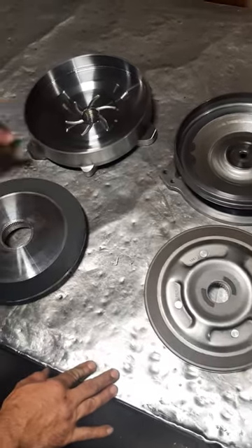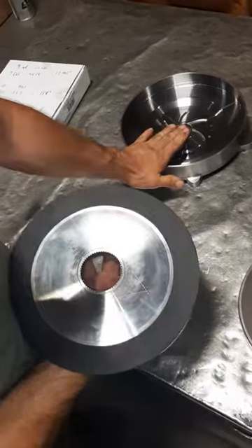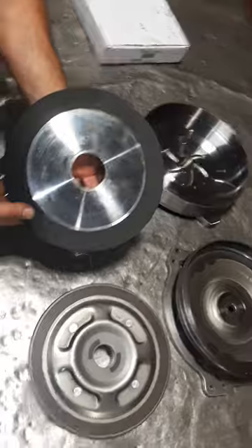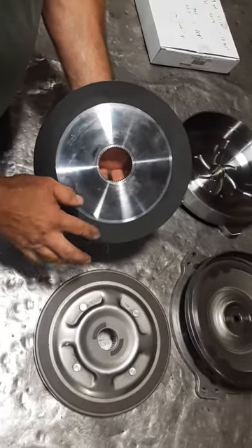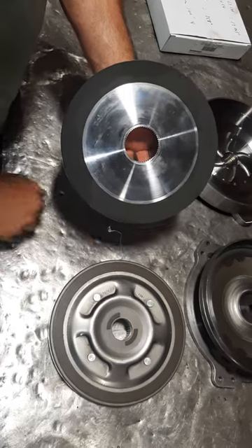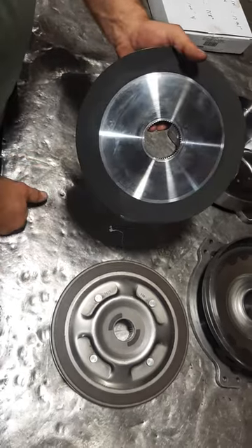When we move to a single disc billet, the clutch — this is the same deal, it's set for a 245 — the clutch material is quite a bit wider. And even though it may not seem like a lot more, that's actually almost exactly double the surface area of the stock clutch. So this comes out at about thirty-six square inches of material.